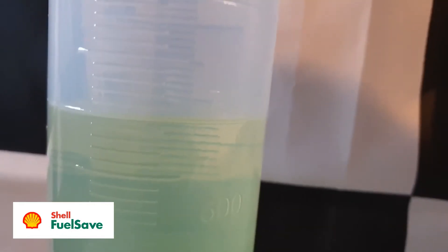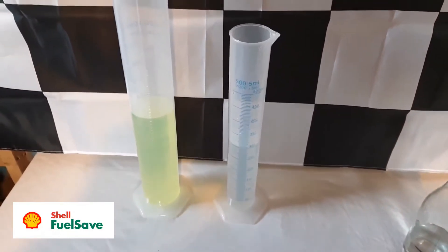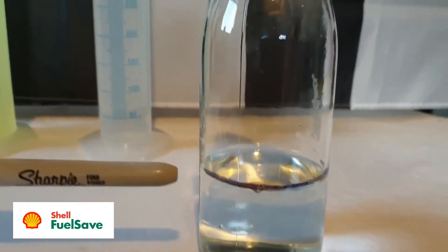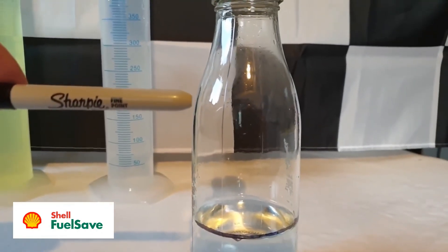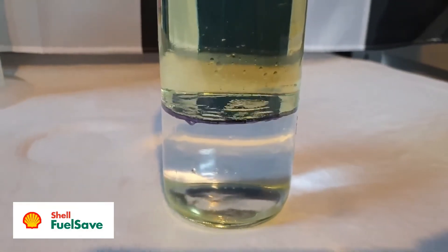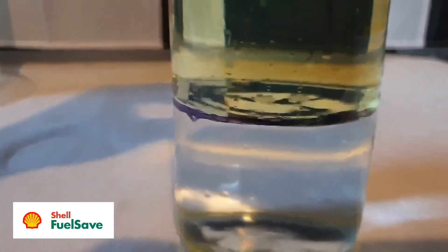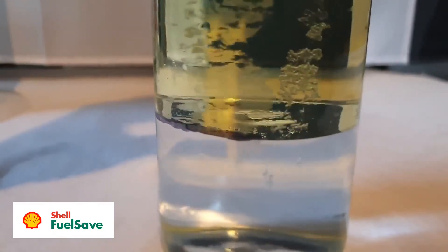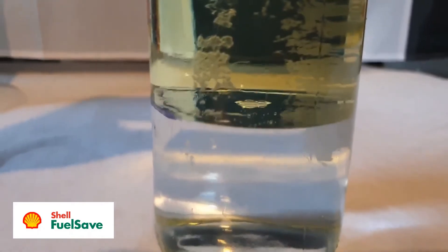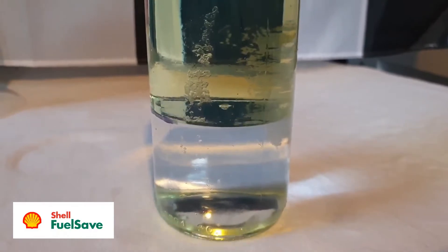I will also be going back to my earlier water line on a glass bottle, as I've had a few people comment on how I need to be shaking up the mixture and leaving it for longer than I have been. So I'll pour the petrol carefully on top of this water with my pour-free method for comparison, then leave a little room at the top so it can be vigorously shaken together, and we can see just how quickly the separation happens compared with pouring the water on top of the petrol in the measuring cylinders, which mixes as it moves through the petrol to sit at the bottom with no shaking or much stirring.